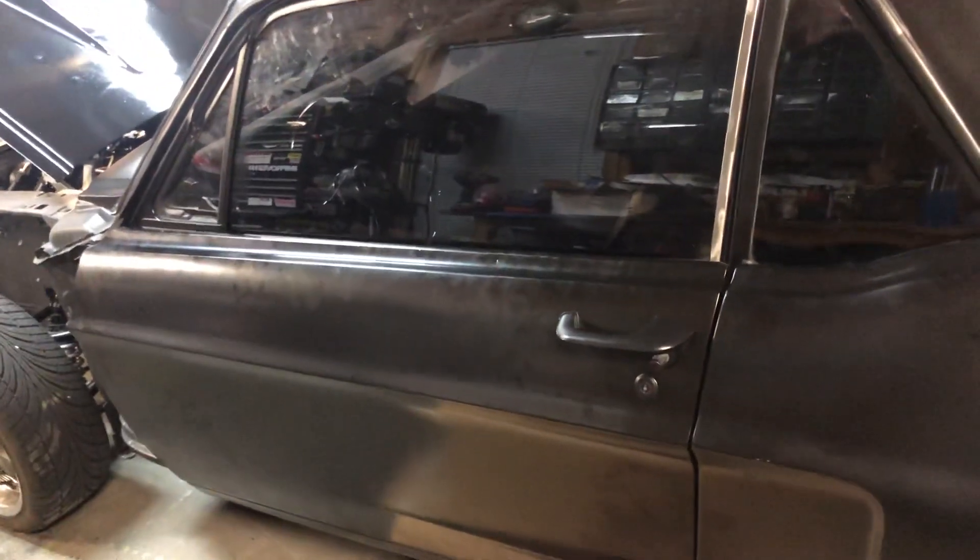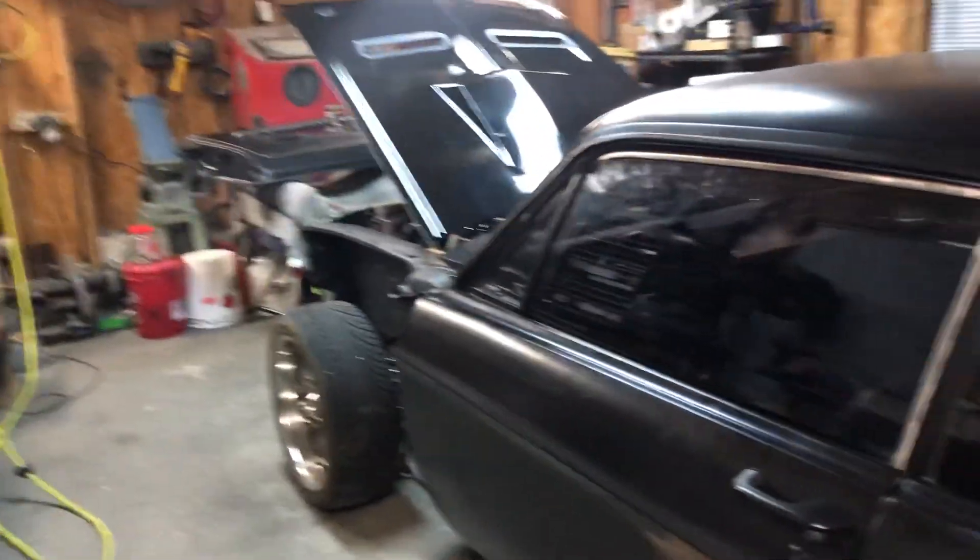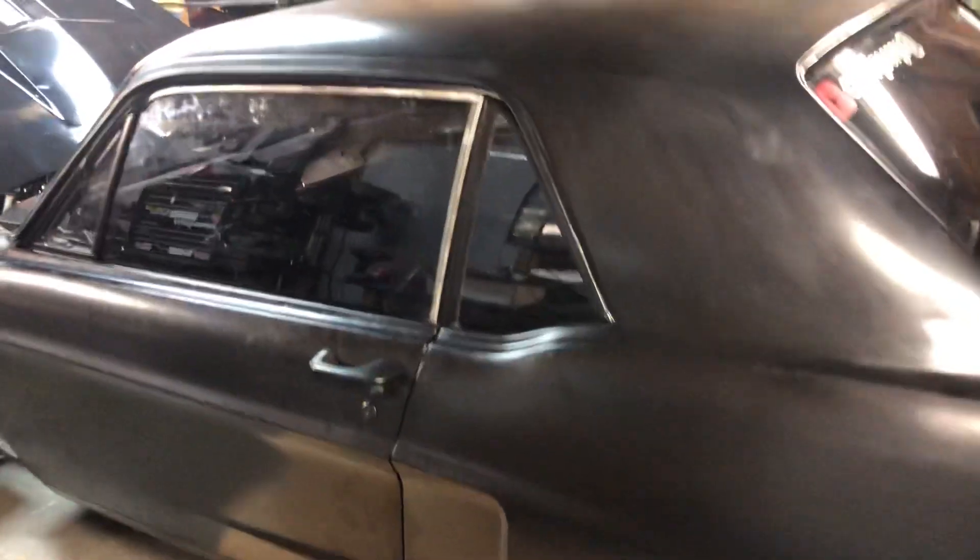Then I'll start doing odds and ends body work on the car — like this terrible slot back here, these quarter extensions that I think I'm just going to mold onto the car, and the holes on the extensions and trunk that I'll probably just epoxy, fill, and bondo. I don't think I'm going to use the deluxe trim with the chrome strips — I really don't want to chrome the car, so I'll do away with those.